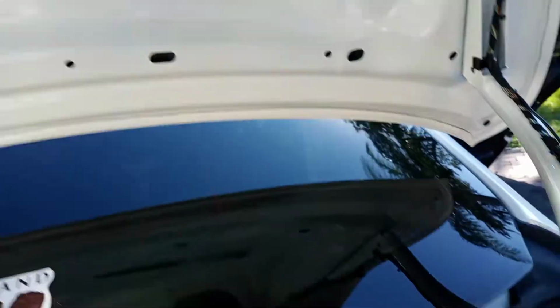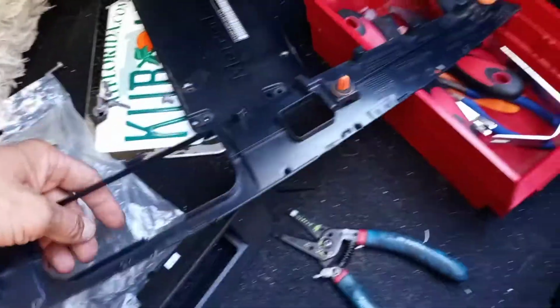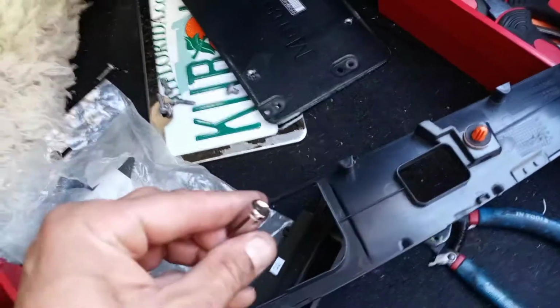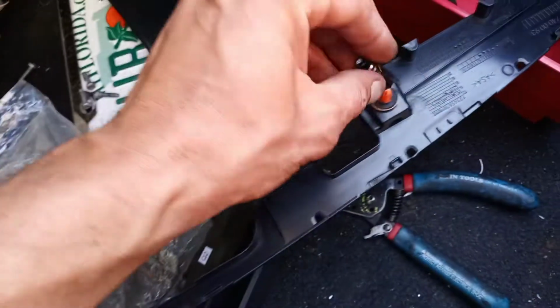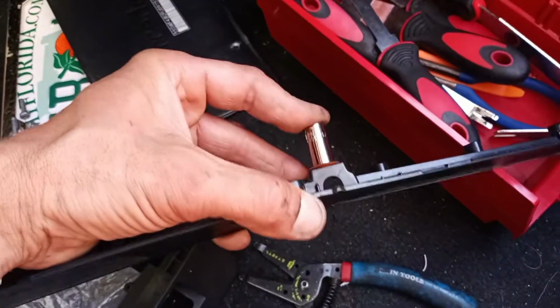and the interior carpet. Now, here's what I have learned. Here's that black piece of trim. Pops in there very easily. People have difficulty with these little orange latches. So, I took a 5/16 12-point socket, which conveniently is very nice and snug on it.